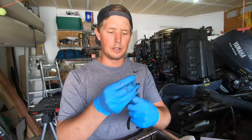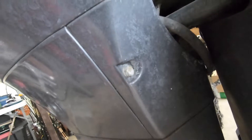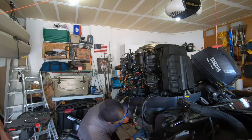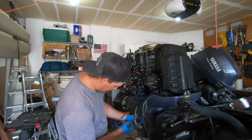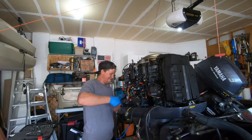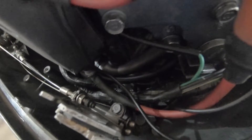Take that pin and slide it back into your shift lever so you know where it is. Now the fun part: there are two bolts on the forward apron — one here and one on the other side — both 10-millimeter bolts, and they slide out really easily. Once you get the forward apron off, it exposes two bolts on the rearward apron — also 10-millimeter. When looking for the last two bolts on the rear apron, you can see the light pouring through. You'll need a flexible extension ratchet to get back in there, and a magnetic tool to retrieve the bolt.